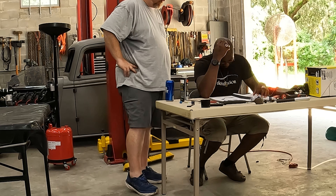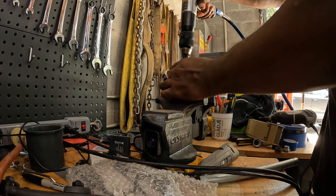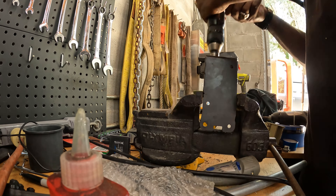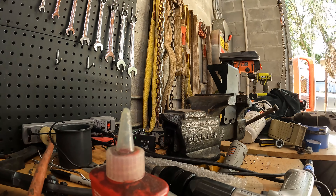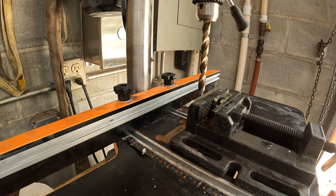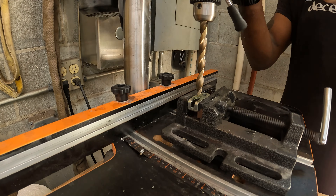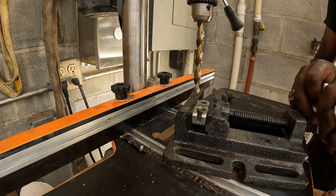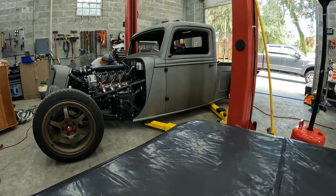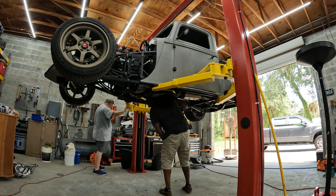Now I'm drilling the bracket. I quickly realized I can't drill it that way with the drill press because it was hitting the side of the bracket, so I ended up having to use a hand drill on that, which is not fun. These are the clevises to fit the actual e-brake cables - I'm drilling those out so I can fit the e-brake cables in there, because I have the stock ones from an '11 GT Mustang. Now we're just lifting the truck to bolt down the e-brake handle on the bottom side.